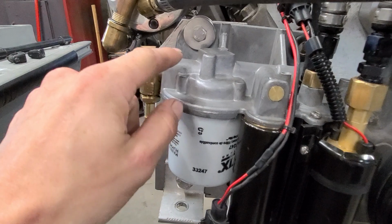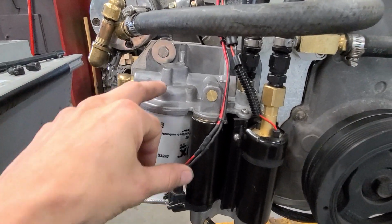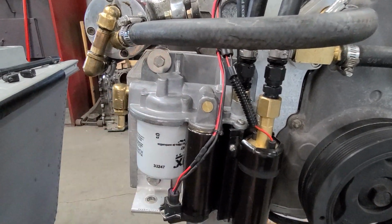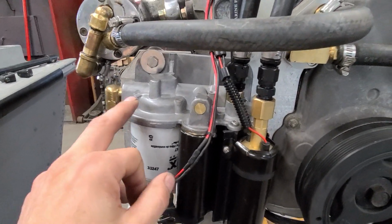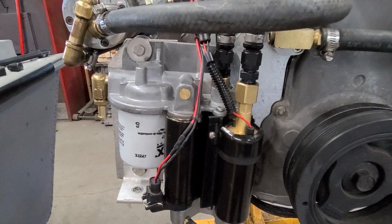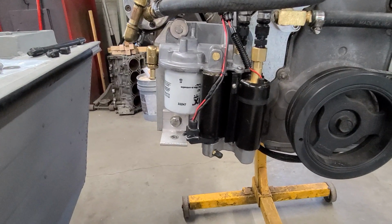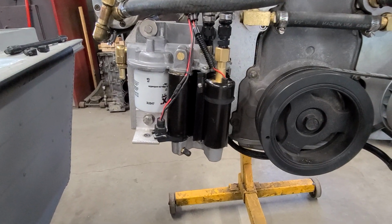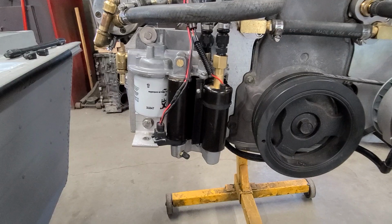What we determined is, like I said earlier, they hang these and they dip them. Well, on the inside of this casting there's a bunch of recesses that, when you dip it, are going to trap air bubbles. So when you take these apart and look at them, you'll see it. There's huge spots that they completely missed. They didn't even get coated because of the air bubbles when they dunk these things in whatever this coating is.